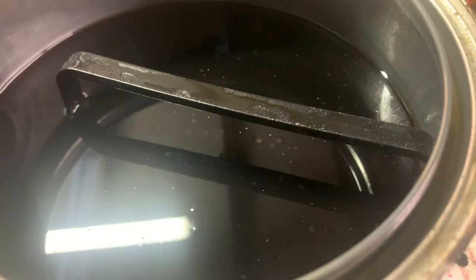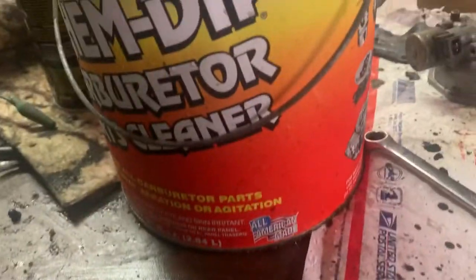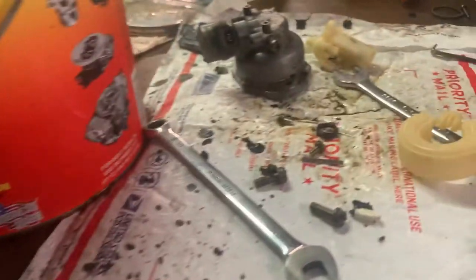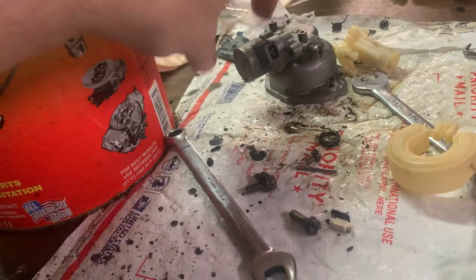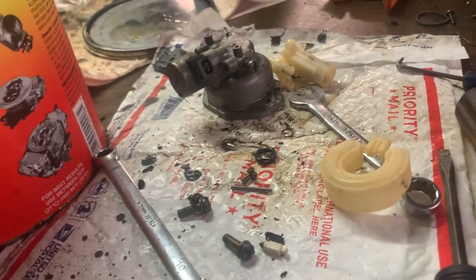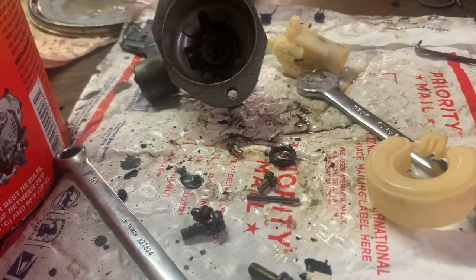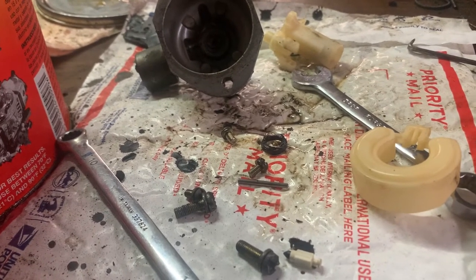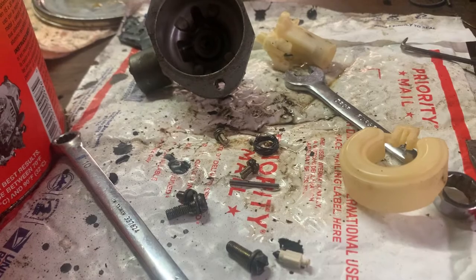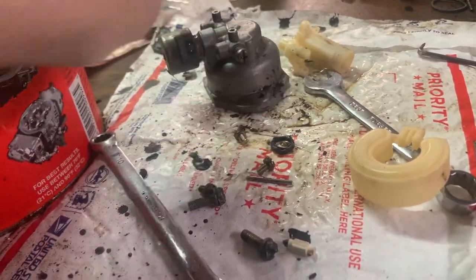The main body of the carburetor is soaking in some Chem Dip - some good stuff from what I've read. The Gunk stuff is not good but this Chem Dip still seems to be pretty good. I could not get this piece off with a slim-down half-inch wrench and I just didn't have a good feeling about it. It looks like this thing is no good anyway because the plunger is not going all the way in to shut that off, so it looks like it's just gone.